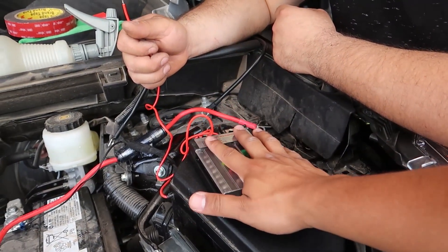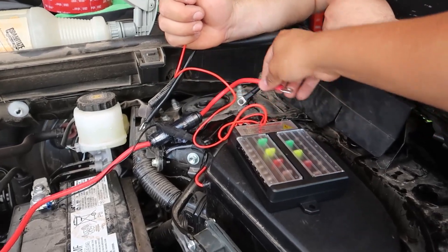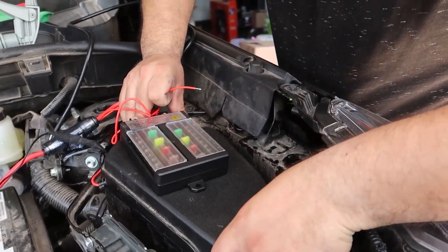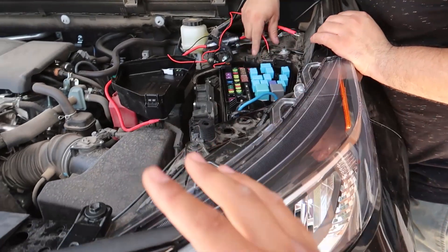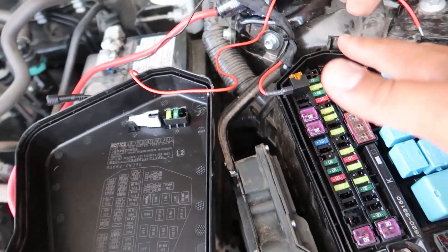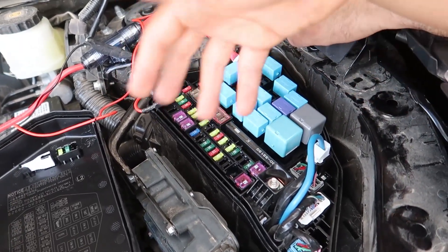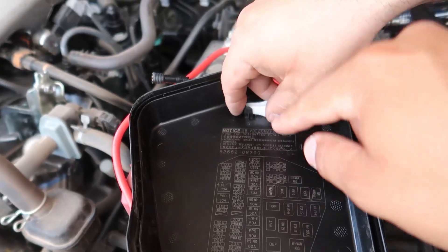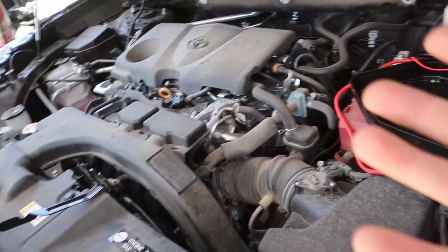Now that we have the Auxbeam fuse box mounted here and the other fuse for the power source mounted there, up next we're going to open up the car's fuse box to show you guys where we're going to be adding the added fuse inside. The added fuse is going to go right here — we're going to actually be putting it into the 7.5 fuse slot. Since we've already checked which one is drawing power, we'll use our handy dandy tool that this car comes with to go ahead and take it out. Super easy, nothing hard about that.